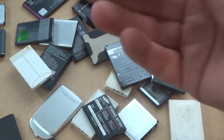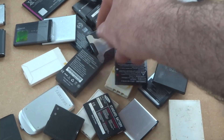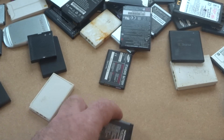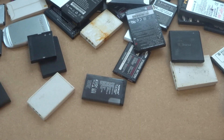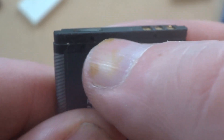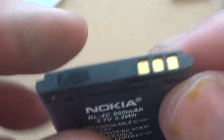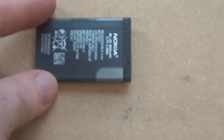Let's pick a battery to start with. We'll go with these Nokia ones — fairly common, from the old Nokias. Again, you have your gold connector up there. I put a board down as a hard surface. Let me get the camera set up a bit better. If you look at the battery, there's a little plastic line running along it, and if I can cut along there without piercing the battery, I can remove the connector without any damage.